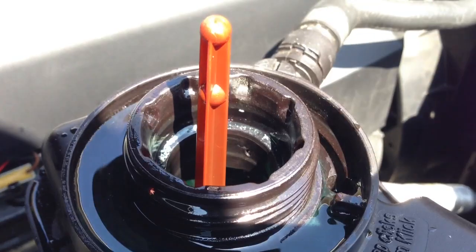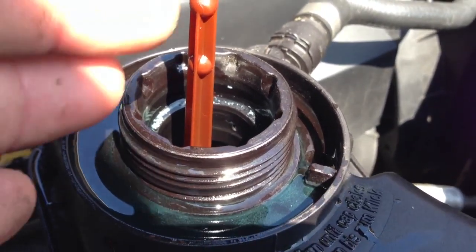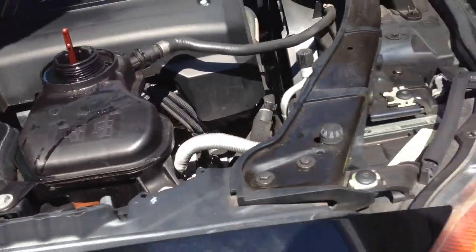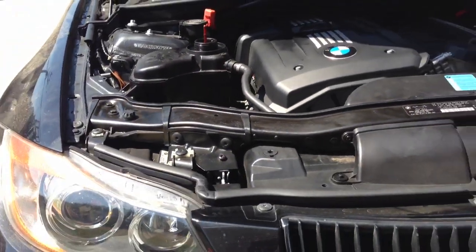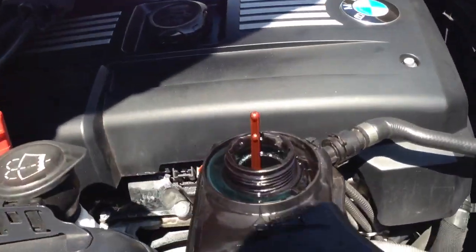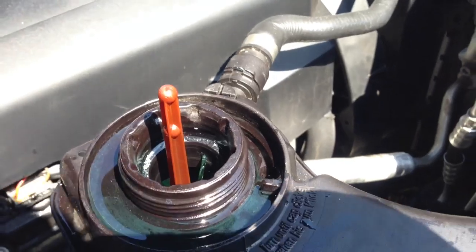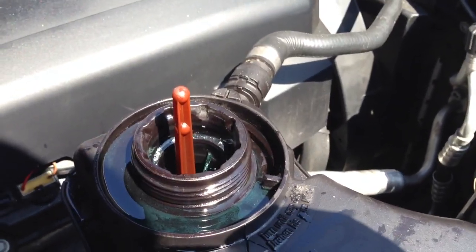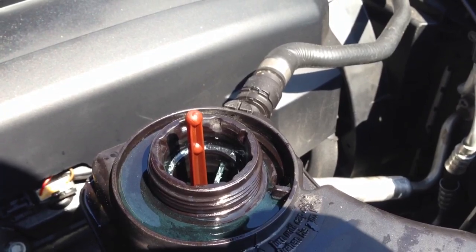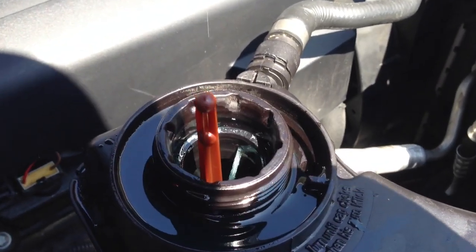So that's how you do it. I just wanted to show you a little demonstration of how it looks like when your car is bleeding itself out. I like the process of the electronic water pump — as you can see it's doing it again because it's going to do it for 12 minutes. As long as you know how to turn on the water pump, it's pretty easy. You just let the car pretty much bleed the air out on its own.